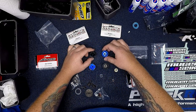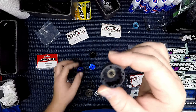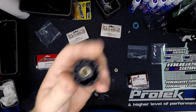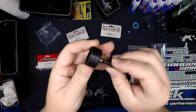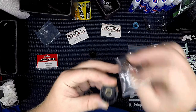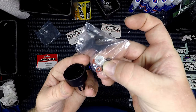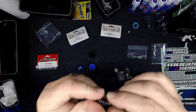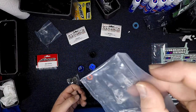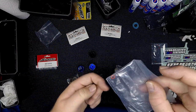The main purpose of this video is really a warning or caution for using aluminum cups. Here's the factory Arrma cup — it's plastic with a metal insert. You put your o-ring down and then there's a metal pin. These pins are hardened steel and they go in this hole with nothing in between that metal pin and the o-ring. So you've got a metal pin spinning on this o-ring constantly, warping it and wearing it out.